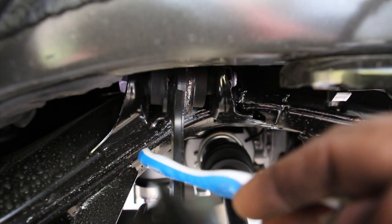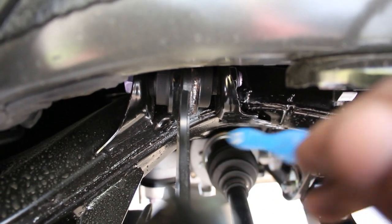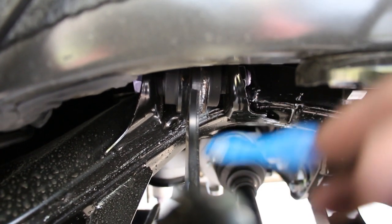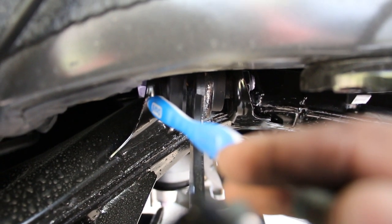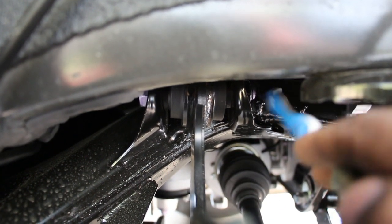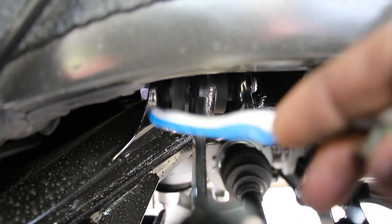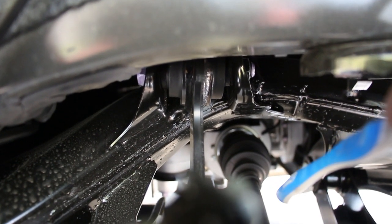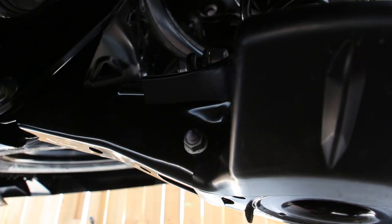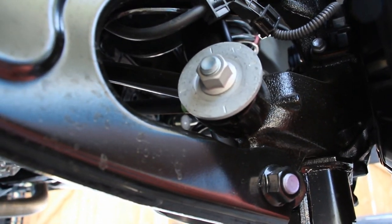For the upper control arm the situation is even worse — they also call for you to remove the entire rear subframe, which would include the differential, any exhaust work and brake lines, in order to change this upper control arm in case the bushings wear out, because the bolt is located on this side and you don't have any access here to get in with a ratchet. On this side there's a little bit more space, so if they just put the bolt in from this side and welded the nut on the other side you might be able to replace it without dropping the entire unit. Looking from underneath you can see there is a camber bolt on the rear lower control arm with an interesting plastic cover for aerodynamics, and another camber bolt on the front upper arm.